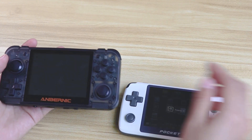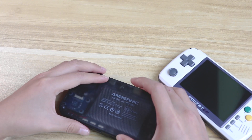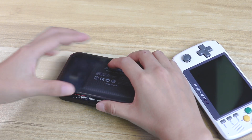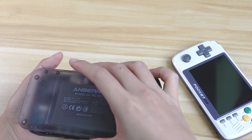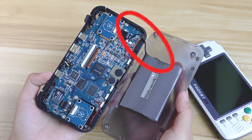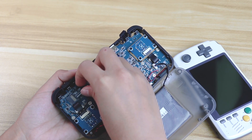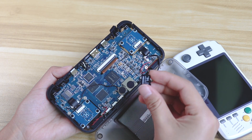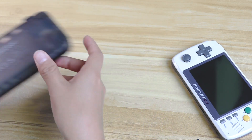We can start to disassemble the RG350 to get its internal SD card out. To save your time, we have loosened all screws beforehand. Pull the back cover a little harder to take it down, but be careful at the bottom-right corner of the unit — there is a wire connecting the battery. Shoulder buttons might fall out as well, so watch out. There should be a sticker on the card slot, but we removed it in advance. Simply tear it off and you'll be able to get the card out freely.